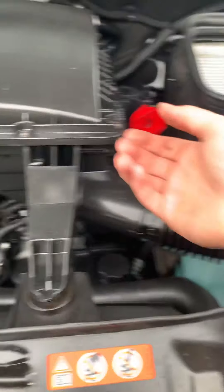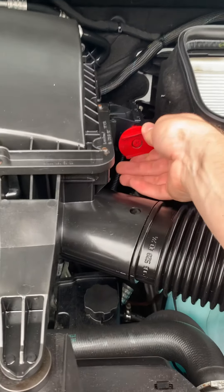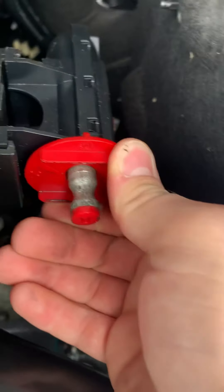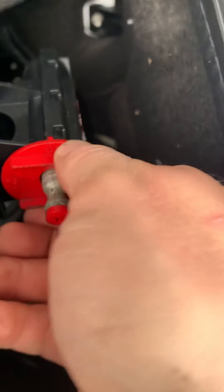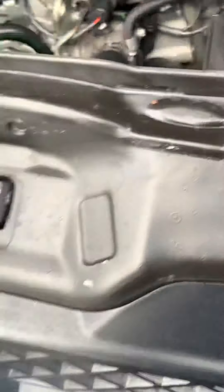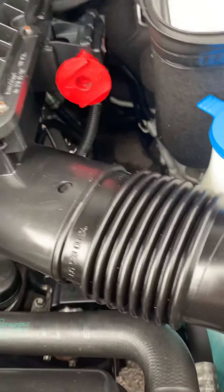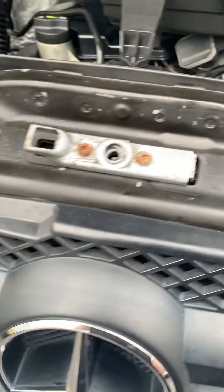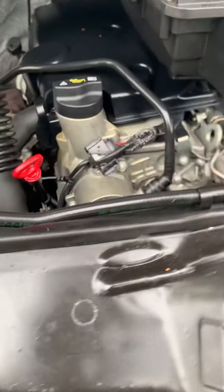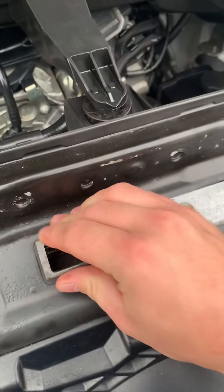Your engine battery doesn't actually sit under the bonnet in these newer style cabs. So to actually jumpstart it, you need to pop your positive on there — turn it to the right, push it in. Positive goes on there. And there's probably a sign somewhere telling you where the best earth is. If there isn't, there normally is — there's usually a little prong of metal, or you can possibly do it off of the front here.